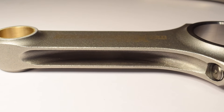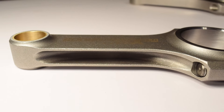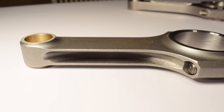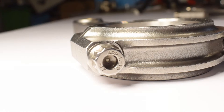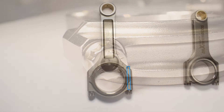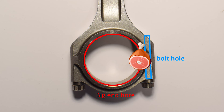When it comes to the blades on the H-beam rod it's very important that they are sufficiently thick; otherwise the rods will be more likely to fail at higher RPMs by buckling, with the thin blades simply spreading outwards and ruining your rod. The bolts are also critical — you want ARP or an equivalent — and you want to make sure there is sufficient material between the bore and the bolt hole, because if there isn't, the big end bore might get distorted, causing increased bearing wear.